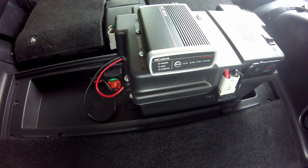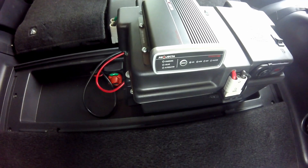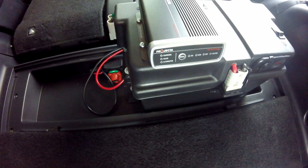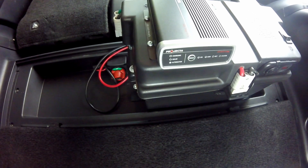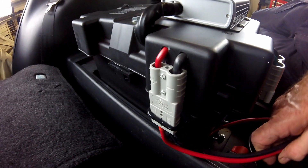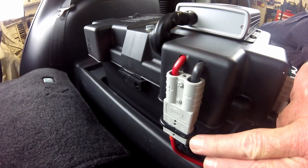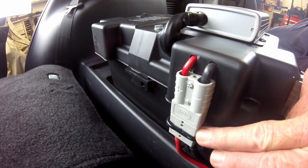With the DC-DC charger it also does that, but in addition it changes the input to an output that the battery can use — essentially about 14 volts and as many amps as you can push at that voltage — rather than whatever voltage was left from the alternator. There is a cable that runs up through the floor, through the switch, and is connected by an Anderson plug to the back of the battery box.